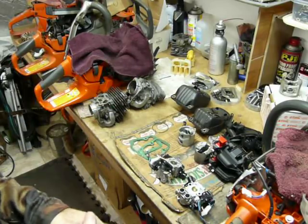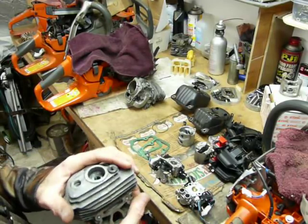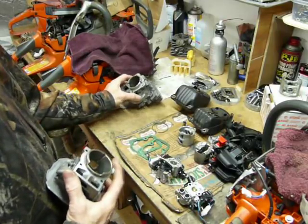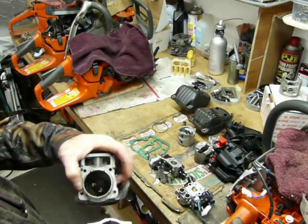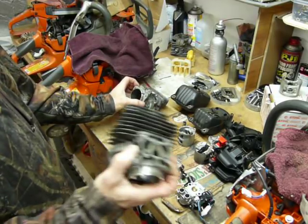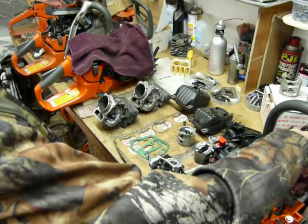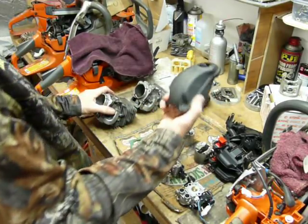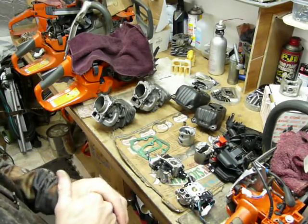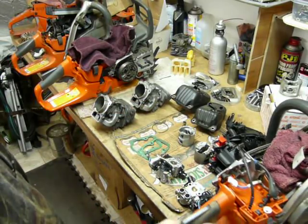Segueing back onto what we're talking about at hand, I did check out quite a little bit if it would be possible to put the 562 top end on the 550. One of the things, we've got a 2 millimeter shorter stroke, which is going to be an issue. We have a much bigger diameter flange. You're going to have to machine the cases out in the 550. There's a lot of things that are cool. Conceptually, I don't know if the coil would handle it, or if you'd have to switch that out. I haven't checked into it that deeply, but you could probably somehow retrofit the small muffler on there to go with the way it's mounted on the cases on the 550, excuse me. Just interesting side notes. Maybe doable, but certainly costly.